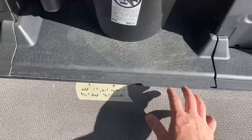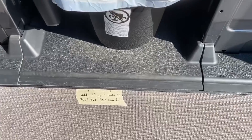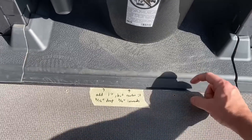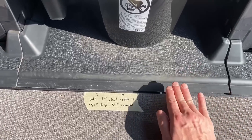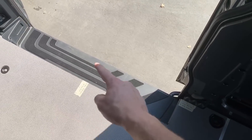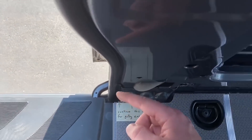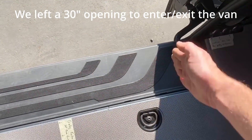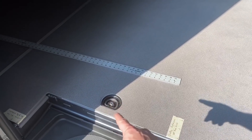The front is a little bit strange — there are factory floor panels with a little extension piece. I'm going to add a whole inch there and then router the bottom side of that wood so it sits flush over the top. We're also going to add an extension here to support the galley unit, continuing the line of the factory floor. This whole spot is going to be covered with wood, and we're going to retain the factory bolt hole locations.